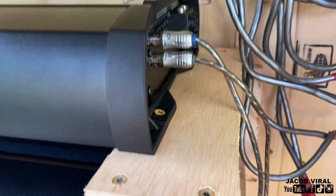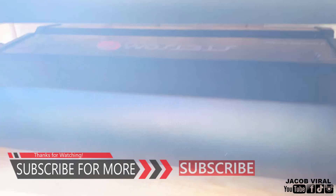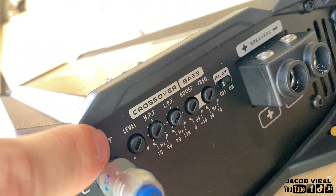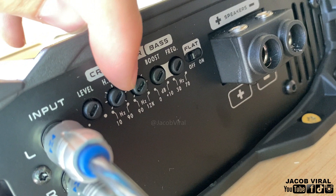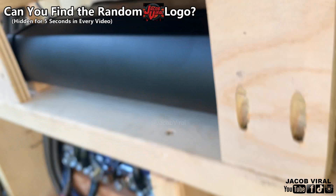First I'm going to make sure things are a little tighter so I can fit the probes in. The ultimate tool I use is the DD1. You don't need a DD1 to do gain matching — on some amps it says 'level' or 'bass level.' All other frequencies I always turn all the way off. Since this is a full range and I'm using bass, I have LPF all the way down to 90 Hz, HPF all the way off — HPF is the subsonic — and bass boost is always off. Right now I have my gain or bass level all the way down.